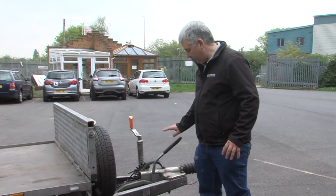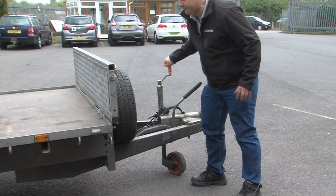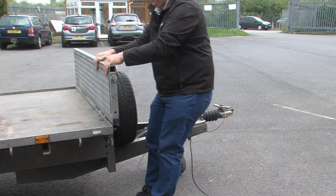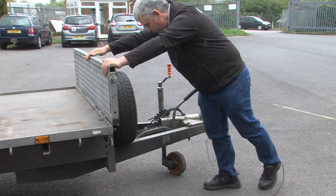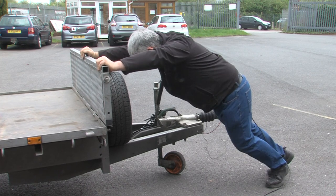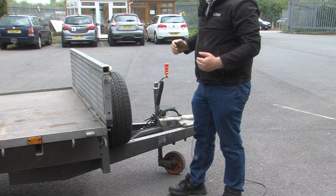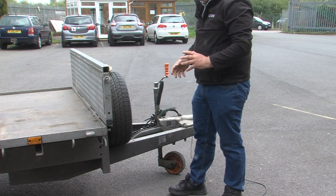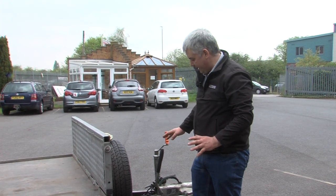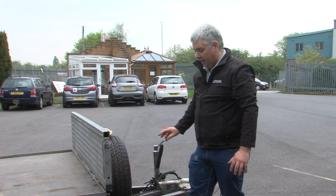A final check on the brakes: with the handbrake on, make sure all wheels are evenly on the ground. Try to pull the trailer forward with all your weight — this trailer won't move at all. Then push the trailer backwards. As you push it backwards, the handbrake comes up fully. This shows that the auto-reverse mechanism is working: the trailer has moved back slightly, the brakes inside the drums have shrunk up, and the handbrake has taken up the excess travel. The trailer will not move backwards.